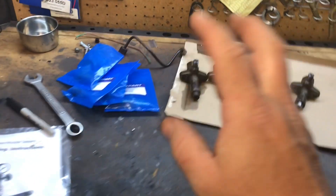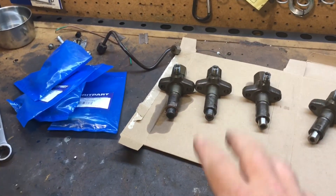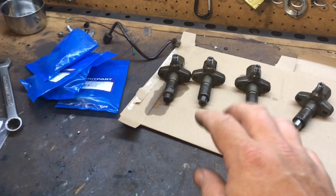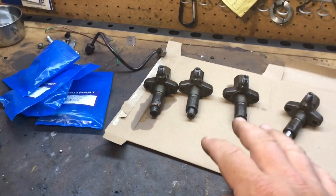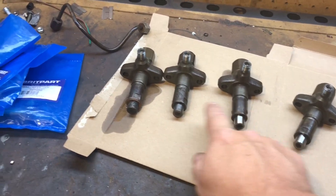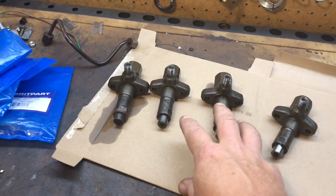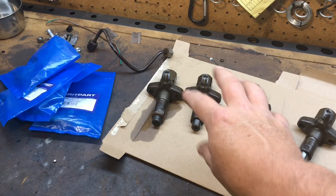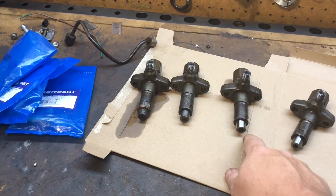Hello and welcome back. The rover — my Land Rover Series 2.25 diesel — seems to be spitting and sputtering and not firing on all four cylinders. When I first got it running I cleaned up the nozzles, took them all apart, and took them to a local diesel mechanic — a diesel shop that rebuilds pumps — and they rebuilt my pump.